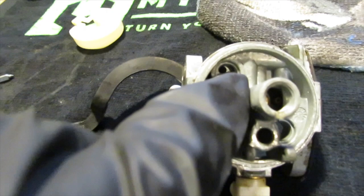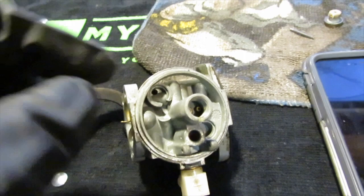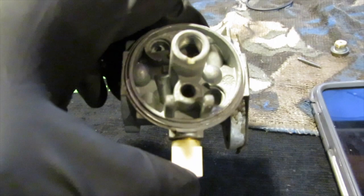What I'm going to tell you is what's missing is this welch cover. What that is is these little discs right here. When I was cleaning it I must have blown a little bit too hard and blew this welch cover out of there and didn't realize it when I put it back together. Put it back together and of course it's getting way too much fuel, so it just has that little small area right there where it allows fuel to come through.